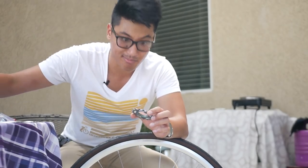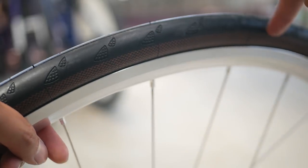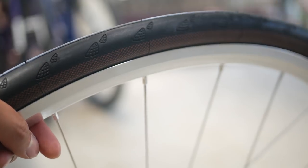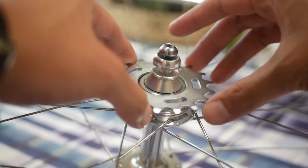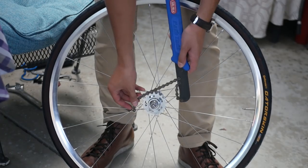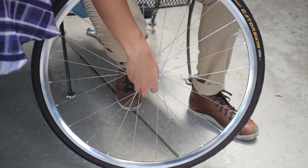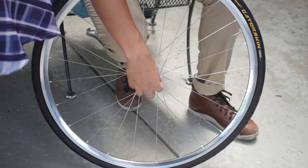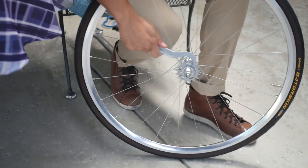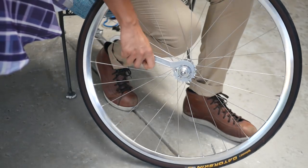Next, we're going to install the cog. Like usual, first we're going to grease the threads. The tread pattern goes this direction, so we want the cog on this side so the tread pattern goes the correct direction. The cog has standard threading, so just turn it clockwise. Make sure you gently put it on and align the threads so you don't strip anything. To fully secure the cog, take a chain whip and tighten it. We're also going to need a lock ring for the cog so that when you backpedal, it doesn't come off. The lock ring has reverse threading, so turn counterclockwise to tighten it. Take the lock ring wrench, get it in one of those notches, and really crank down on it. It's really important to get this thing tight — if it's not tight enough, your cog could slip, which could be really dangerous.